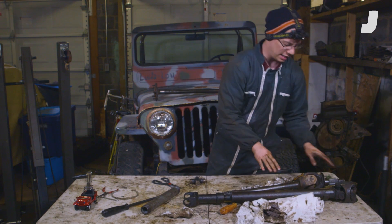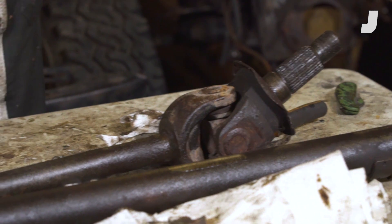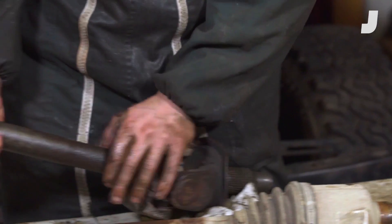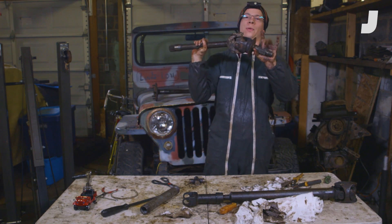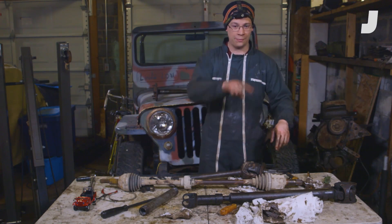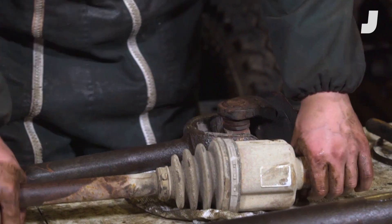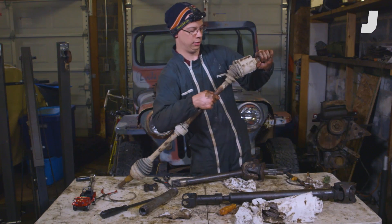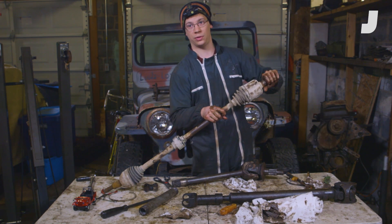The downsides of a U-joint connection compared to a CV axle — a U-joint is a very simple device, very cheap, very strong, but it has an Achilles heel. When this is at a steep angle, this shaft's rotational speed is actually different from this one's. This shaft will be spinning at a steady rate while this shaft will speed up, slow down, speed up, slow down — and that will manifest itself in a jerky ride. That's why this is called a constant velocity joint: even if it's at a steep angle, this rotational velocity will equal your wheel's rotational velocity.